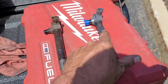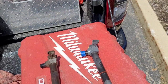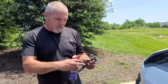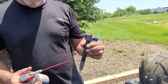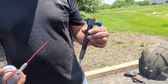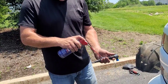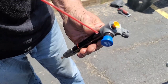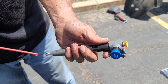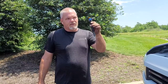I'm going to find something to slick this up with and shove that back in the hole. Just in case we didn't tell you guys, we are here at the Bass Pro Shops in Portage, Indiana. This little O-ring right here — I'm worried about it because when I push it down through there I do not want anything to cut that O-ring. I like using Dawn dishwashing detergent — that's my go-to — but I don't have it, so WD-40 is going to have to be a substitute. I'm just soaking it; I want it as soft as it can be when it goes in, but you don't want to get it into any of these holes right here — just on the O-ring. I'm going to slip this so this port faces the fuel line we just took off and this faces the electrical connection we just took off, and I'm going to slip it back down in the hole.